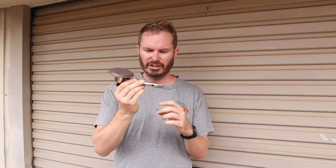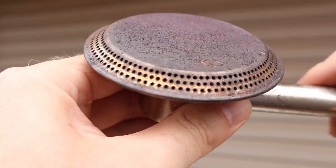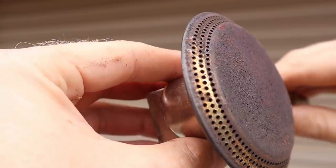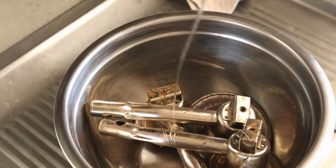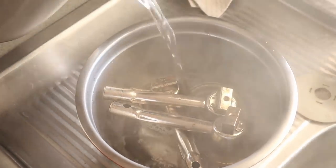Sometimes you even get bugs nesting in them. There's this rumour that earwigs love the smell of gas, and spiders could have nested in the little tubes — so just clear it out. Make sure you have a good glance over all of these holes and make sure they're not clogged up, because obviously if they're clogged, gas can't flow through them. Now my burners are actually pretty greasy, so while they didn't seem clogged up, I'm putting them in some boiling water with a little bit of dishwashing liquid just to break all that down.